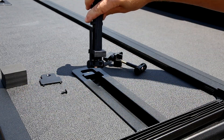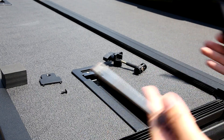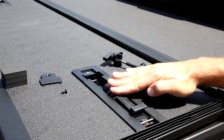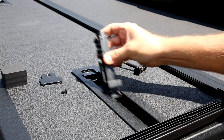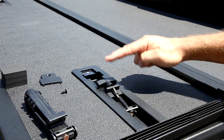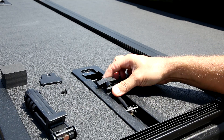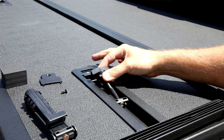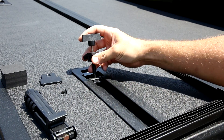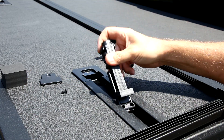One thing — when we move this in, I'm going to leave this plate off, basically because when I want to flip this whole thing up to access like two thirds of my truck bed, I need to flip it over and fold it on top of that part. The issue is that the speed clamp is designed to fold pretty much flush, which the jaw clamp does not. So if I fold it up, I'll put a dent on the top of the other side, which would be pretty ugly since it's on the outside and pretty visible. So I'm going to leave this plate off.